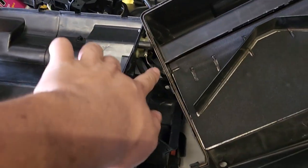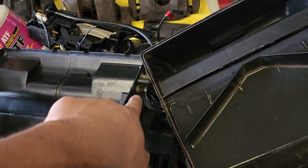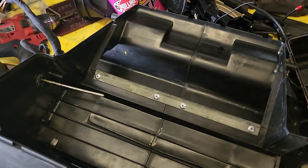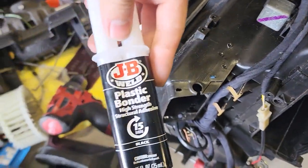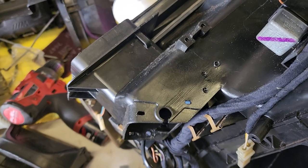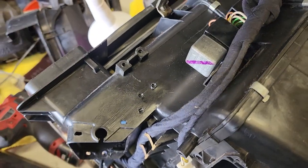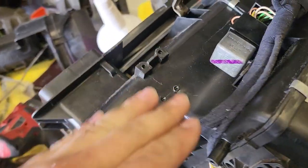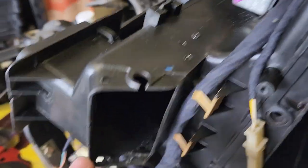Now I'm going to modify this so we no longer need the third lever. I went ahead and got the rivets in. I'd already put the bottom piece on and all the other retainers — just recommend don't put the bottom piece on until you're done with this step. Go ahead and close this up and then throw the radiator back in. I got some plastic JB weld in those holes with a little bit of blue tape on the inside. It says wait 15 minutes until it cures — I'll remove the tape, and if it needs another skim I'll do another one. It just needs to seal.